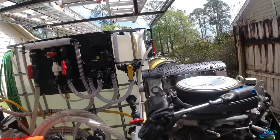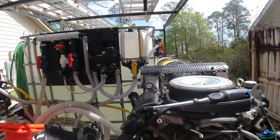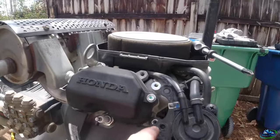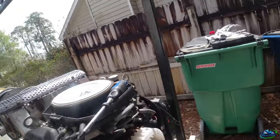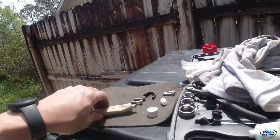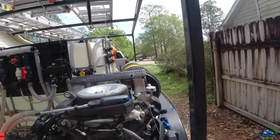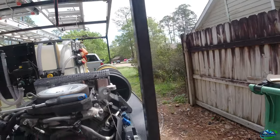Coil number two. We were able to unbolt it — it's strapped to this black wire, both of them. So we're going to re-strap them, tie-strap them. Got a connection off. We did have to take off the fuel pump mounting bracket bolts and push it out a little bit to squeeze the plug through. We're going to go ahead and reinstall it. This is the anti-seize thread lubricant. We're going to put that on everything before we put it back.